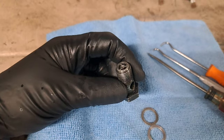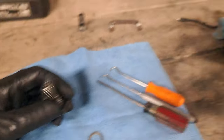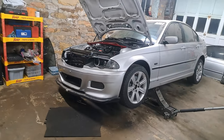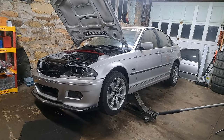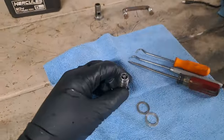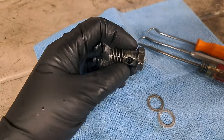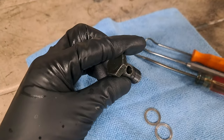This is a very common modification known in both the drifting and racing communities. There are two versions of power steering pumps for these cars: the LF-20 and the LF-30. The LF-20 loves to shear off the shaft internally, and I'd expect that happens less if these restrictors weren't added from the factory, since that pump is working harder to force fluid through the banjo bolt.